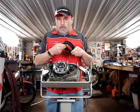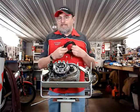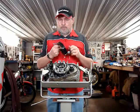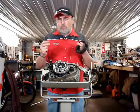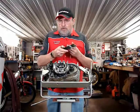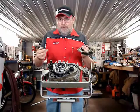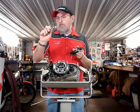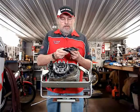And I want to speak about oil quickly. The reason we don't use synthetic oil, we never recommend synthetic oil, is there's several reasons. One is it's too sticky and it causes the clutch to drag. You just need to use normal motor oil. Using the normal motor oil, 5W30, the clutch will work perfect and you won't have problems with dragging. So checking every single one of the fibers to be sure that the material is bonded to the plate,